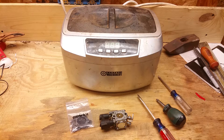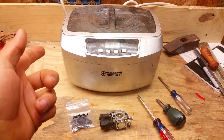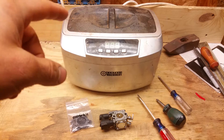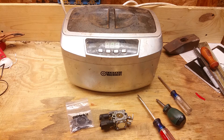The old-school way is a bucket of carb cleaner — I don't have any here because I don't use that nasty stuff. Carb cleaner spray, I don't use that either because if you breathe those fumes enough it'll probably make you sick, and it's expensive. We don't need any of that stuff anymore. What we can use is just straight water. I know some guys put Simple Green or a little bit of soap in there, but I like to use just straight water and then blast out whatever's left with compressed air.